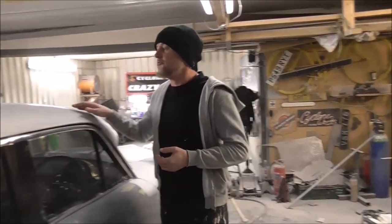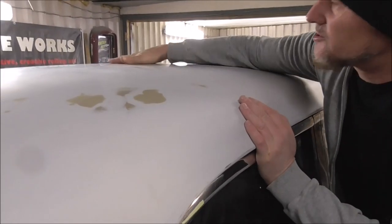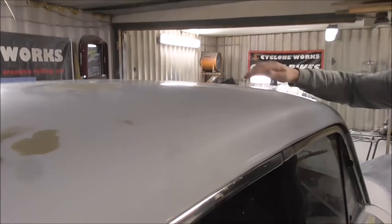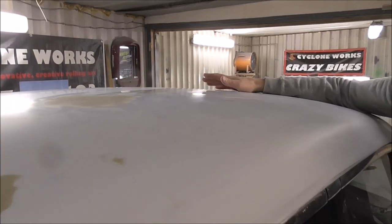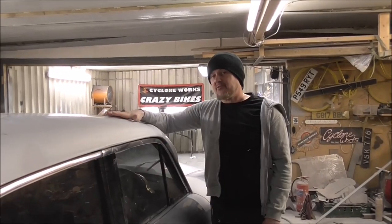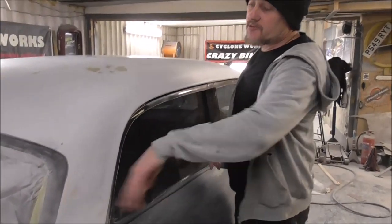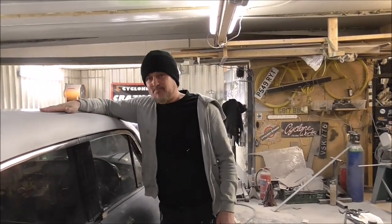If you look at this roof - I thought this was pretty good, but I've put just a thin skim of stopper in there. This has been sanded so much it's almost got a sheen to it. I probably won't be going any smoother because I do want the paint to key to that. The roof is going to be a different colour. So what I'm going to do - again with the Top Gun - is mask the windows and mask the whole bottom of the car and get this part painted.